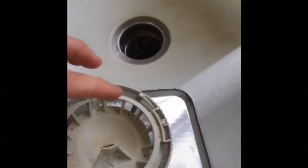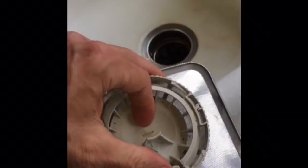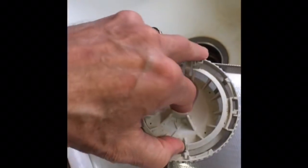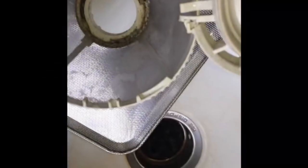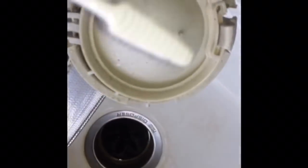This is the triple filter. You can clean it with an old toothbrush. Open up this part by pressing in on this tab, put your other finger on the other side, and pull up — this will hinge open. Once it hinges open, get in there with a toothbrush, some water, and some soap, and clean all around the perimeter to get all that junk out of there.